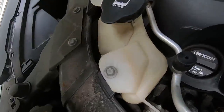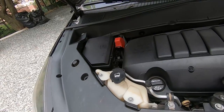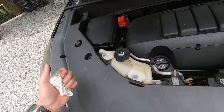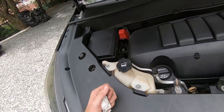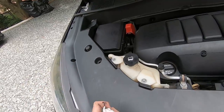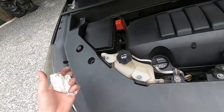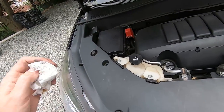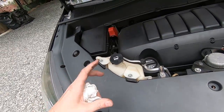The radiator cap is right here. Make sure you don't open this when the car is hot, because if you open the radiator cap while the car is hot, you're gonna get boiling antifreeze in your face and that's gonna lead to injuries. Check your owner's manual for the specific coolant the car uses, but in extreme situations if you have to drive from point A to point B on a short drive, you can use any coolant or regular water. But don't leave water in the system if it's below freezing temperatures, because it will freeze, the ice will expand, and you might crack something.